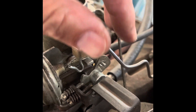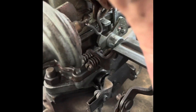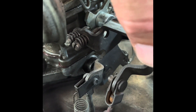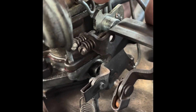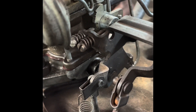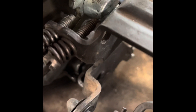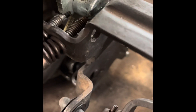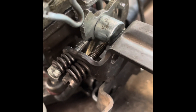As the engine warms up, the choke will relax. When you hit the throttle, you can see the fast idle cam moves out of the way and you go to the regular curb idle, which is that second screw that just hits the shaft. That would be your warmed-up condition.